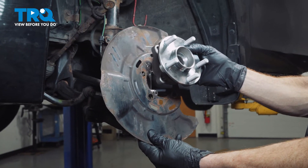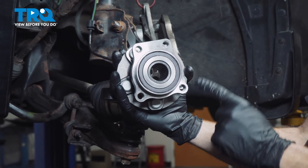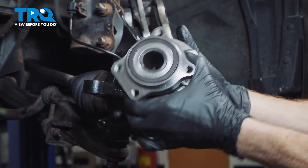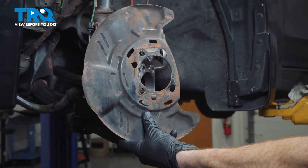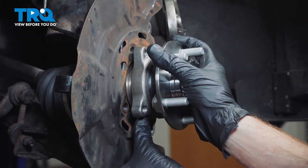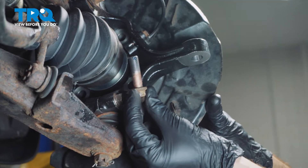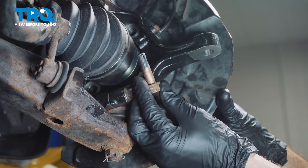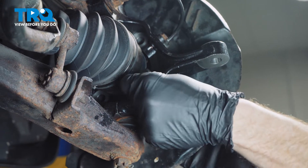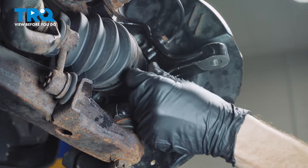Now we can get ready to install our wheel bearing and our backing plate. Have a quick look at the backside of the wheel bearing — you'll find four bolt holes, but along the top the two bolt holes are a lot closer together than down along the bottom. If you have this upside down, it's just not going to mount properly. Take the backing plate, put it right along the knuckle, then take the bearing and slide it onto the axle and press everything together. Once slid in, continue along the backside and put in your four mounting bolts. Apply a thin amount of blue thread locker to the bolts, and on the shanked area apply a little bit of copper anti-seize. Slide each bolt through the hole in the knuckle, through the hole in the backing plate, and start it into the threaded area of the wheel bearing.